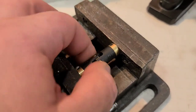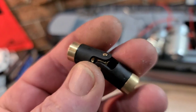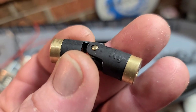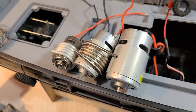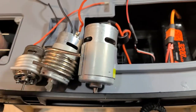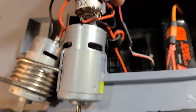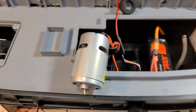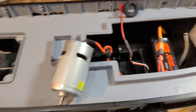It's the next day — everything's cured out and it turned out pretty good. I'm going to give it an extra day before taking it out so I know the epoxy is completely set. First, I wanted to give a comparison: 380, 540, 700 — that's a big motor. A 700-size motor in this boat has a lot of torque, so anything that gets on your propeller is definitely going to do some grinding. Plastic on brass.